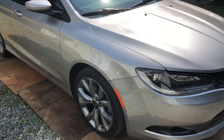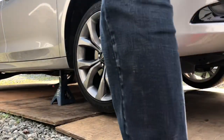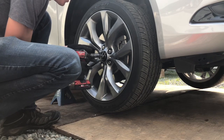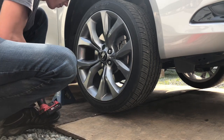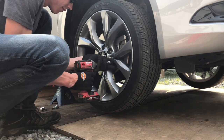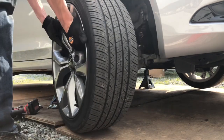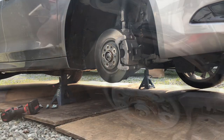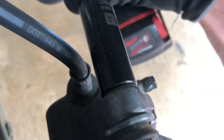I'm going to skip the whole process of jacking the car up and go straight to pulling the wheels off. We're going to start taking the wheel off — it's just a 19mm. Once you've got the wheel off, you're going to come back to the caliper. Right on the back there — that's a 14mm, so I've got the drill here with the 14mm on it.